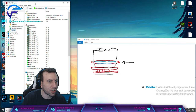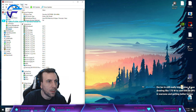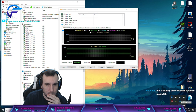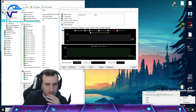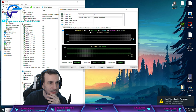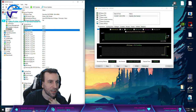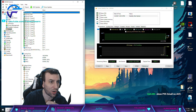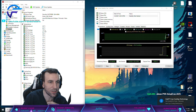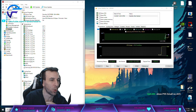Look how fast this thing responds - I'll show you right now. Let's do a light load here, standby mode. CPU package is at 63... it just starts skyrocketing - look at that, 71 Celsius with 150 watts! Let's turn the cryo on. 80 degrees - it's essentially not being cooled, it's like a passively cooled copper plate.